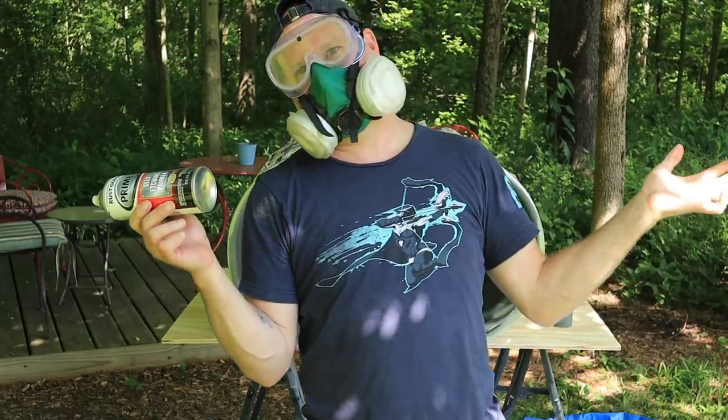We ran out of the etching primer. We managed to get 1 coat, a few spots that still didn't get covered by the etching primer, so we're gonna have to go get another can because you want to do like 2 to 3 coats.